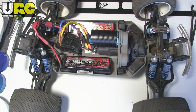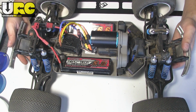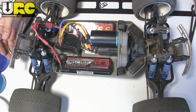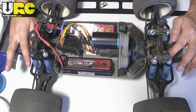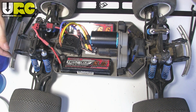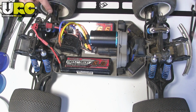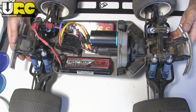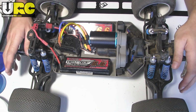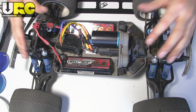Oh, another thing I'll do is give all the moving joints a shot of mousse slick to keep the squeaks away and keep those joints moving freely, so that my hinge pins and pillow balls, shock ends, the eyelets themselves, will not be acting as friction dampers, because that does not help at all. It makes for a bouncy ride. So there we go. That's it for this one.